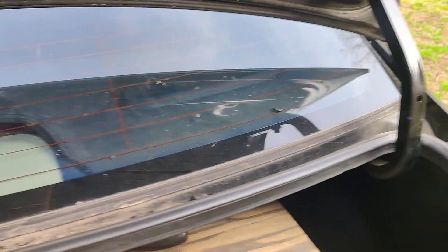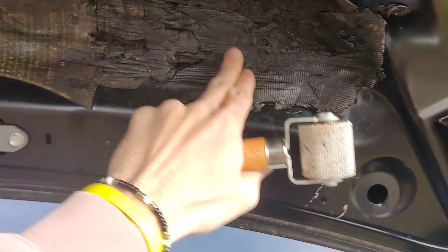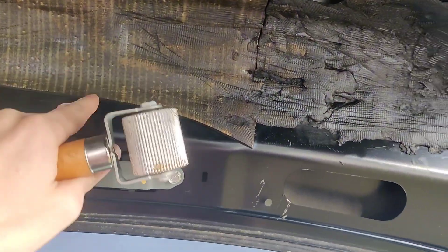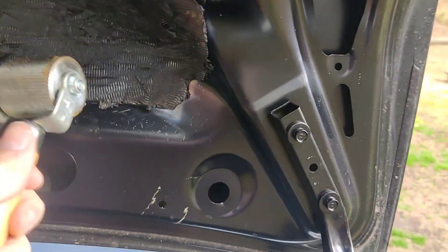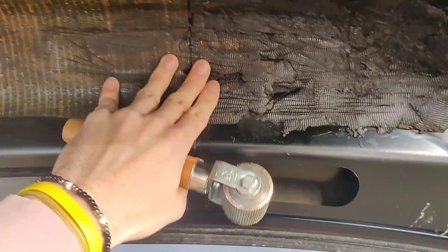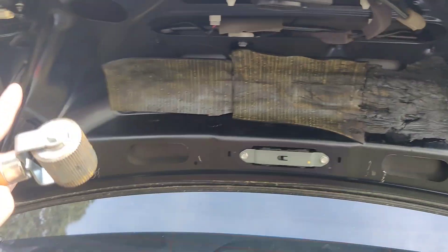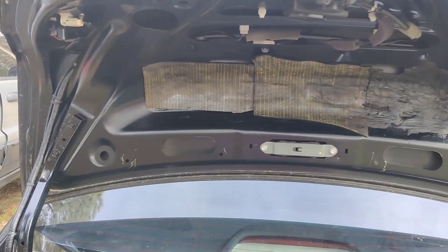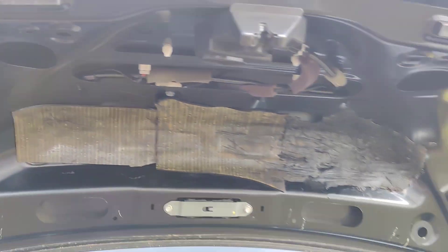Then go back over it and make sure it's really kind of a black-brown material, because you really don't want to see a lot of yellow — the more you heat it up, the stronger it's going to get and the more you can roll it down. The idea here is I'm going to put probably one or two layers across here and try to get some on the lid right here. That'll probably be all for today — I might eventually get down here and on the sides, but just for today I'm doing the trunk lid.